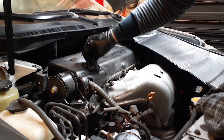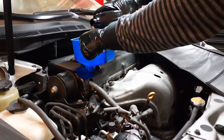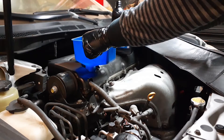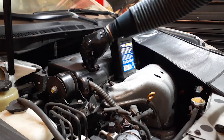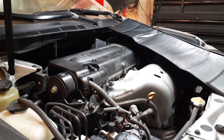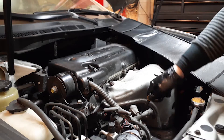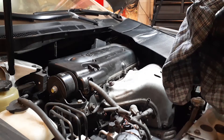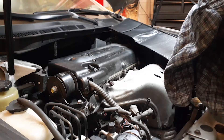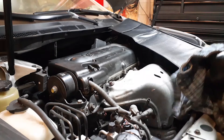Using the oil cap — grab your oil. Cap back on. Give it a few moments for that new oil to run down into the oil pan so you can get an accurate reading. Wipe your dipstick once again. Sometimes when you look at the dipstick on a Toyota, it looks like it's all over the place — just keep spinning it and you'll see a line. The lower line of where the oil is is always the correct one, not the high one; that's just oil splattering. So we have a good oil level — the oil change is complete.